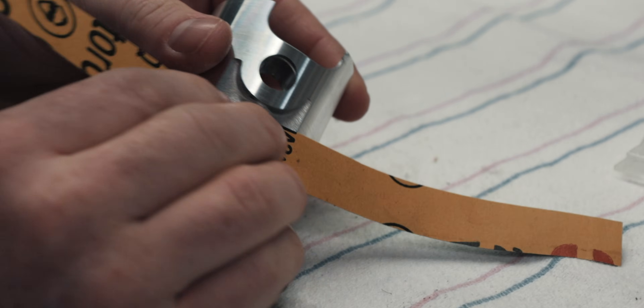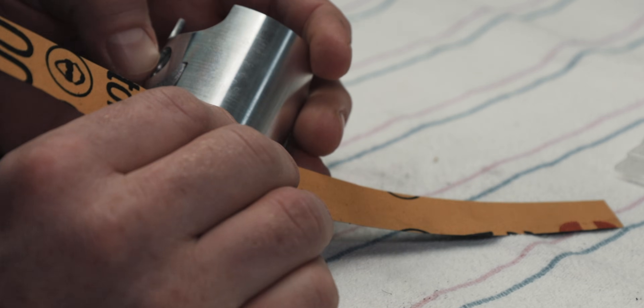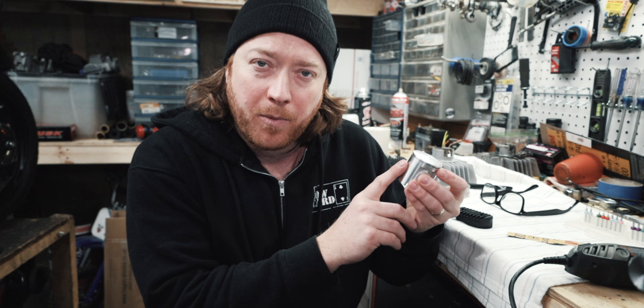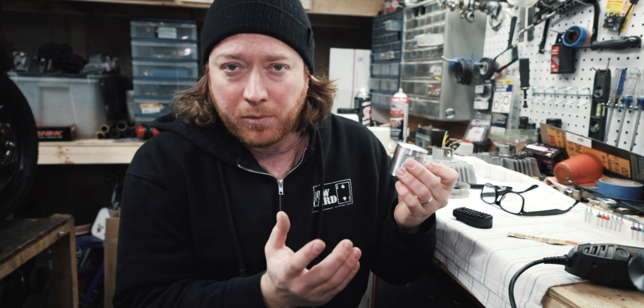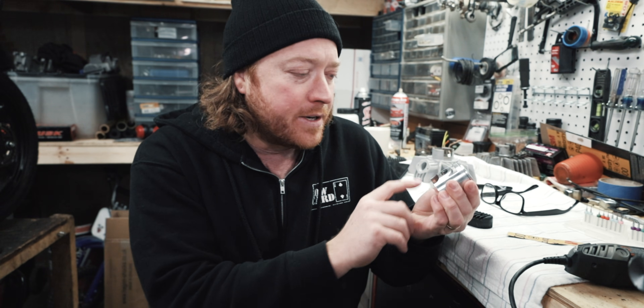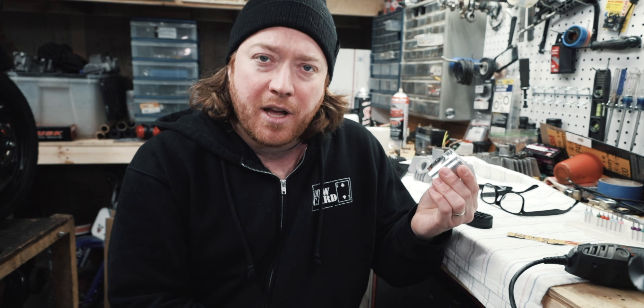You can take a little piece of sandpaper and just make sure that they are smooth. They are really small but they do not need to be big. This method only works on a single ring piston. That doesn't mean you can't use a piston with two rings — you just have to remove the lower ring. Now that these ring lands are ported, do the rest of your normal piston preparation: sand and chamfer all the edges and it's good to go.